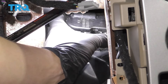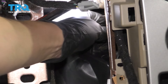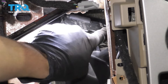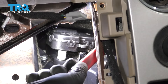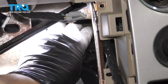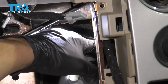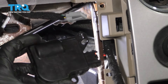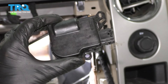Now we can pull this up and off. You can't go very far with the harness, but if you just reach your fingers in there, you should be able to disconnect it. There's a red locking tab right behind there — I'm just going to use this trim tool to pry it away. Once that's pried away, just stick your hand back here and push the tab down. Make sure you don't lose the wire back there. And here is the actuator that we are after.